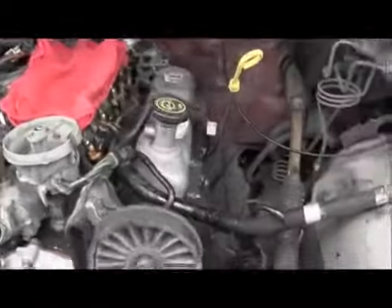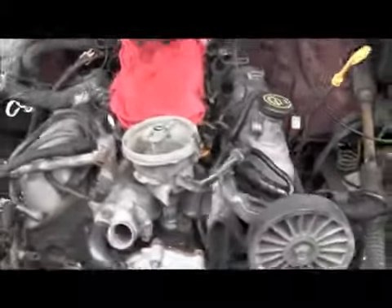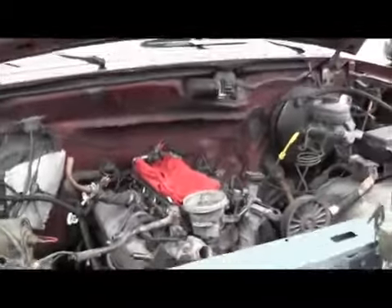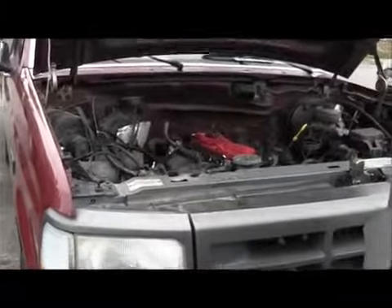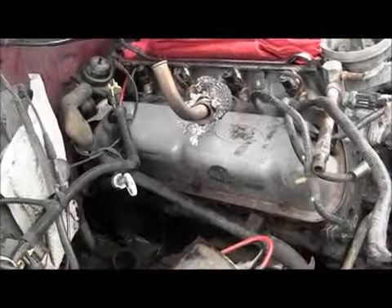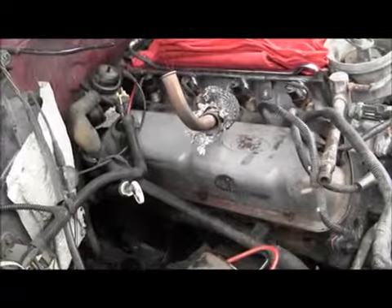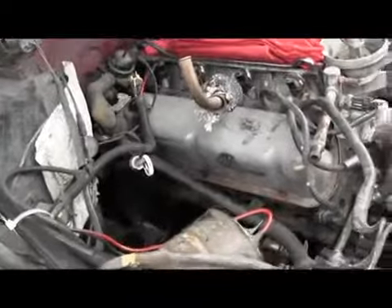You have the power steering and all that, right? That's right there. I was going to say I've got one at the house yet. So I was just waiting to put that manifold back on. We got that. Missing a few other bolts and bits and pieces. I've got to find the starter bolts — I don't want to put the manifold on until I find the starter. There were no bolts in that other one because it actually bolts to the transmission. The only thing left on that other motor is just the plate on the backside.